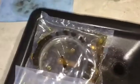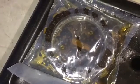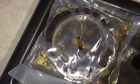Okay, so the most important thing with the friction plates when you put a new set in, you want to soak them in oil for at least 2 hours. This allows the disc to absorb the oil that they need to function properly and work smoothly. Without the oil, when you disengage the clutch, you will feel almost like a gritty feeling as you are in the friction zone. It won't be smooth, and it'll actually potentially cause damage to the friction plates. So what I do is I just use the bag they come in, cut a hole in the top, and fill the entire bag with oil, and make sure that the plates are soaked. So that's what I recommend there. You can put them in a bucket, but it's easiest just to use the plastic bag that they come in.